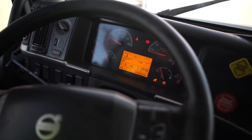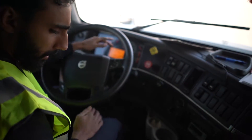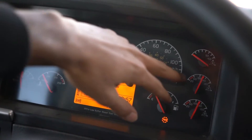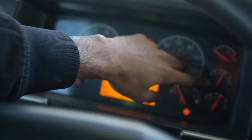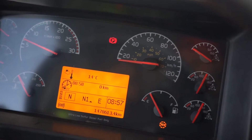My wheel blocks are applied, my brakes are applied, and the truck is in neutral. For the audible air leak and air loss rate test, it's very important that your pressure is at 100 PSI — both primary and secondary. Make sure both pressures are exactly at 100. We already built the pressure up from before, so we're good to go for this test.